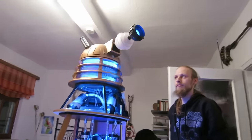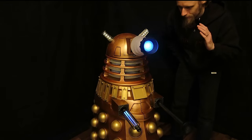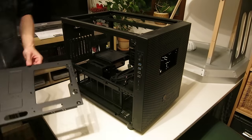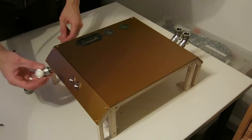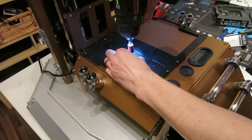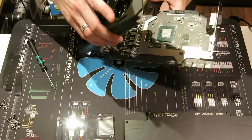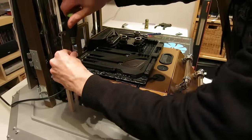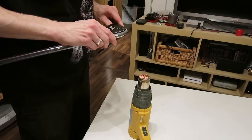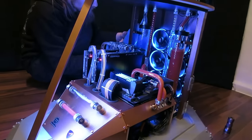And the first test. Now I disassembled the case and fitted the parts into my mod. For the custom made water cooler I had to cut precise openings where the loop can be connected to the hardware. All cables were sleeved in gold and carbon black. I adapted motherboard and graphics card to the water cooling system and assembled everything. The tubes were made of acrylic and can be easily bent upon being heated up. I created two independent loops and filled one with rusty color and the other with blue liquid.